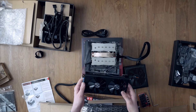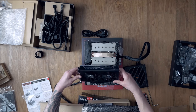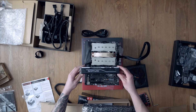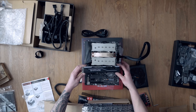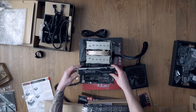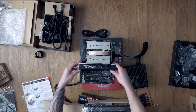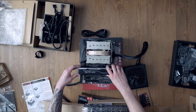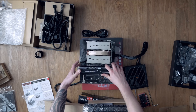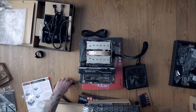For GPU installation, find the correct PCIe X16 slot — this is the slot that shares 16 PCIe lanes with the CPU, giving the GPU the most bandwidth. Like with the RAM slots, open the clamp first, then push the GPU gently into the slot. The clamp automatically snaps in because of the pressure. That was easy.